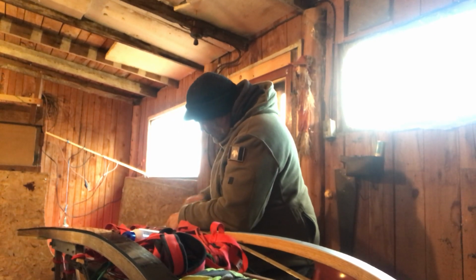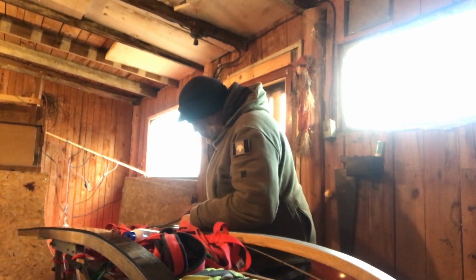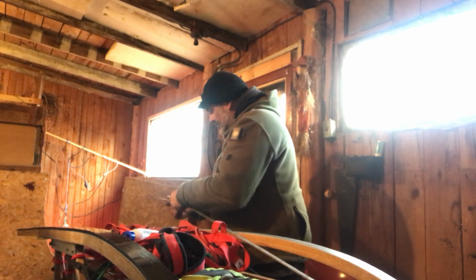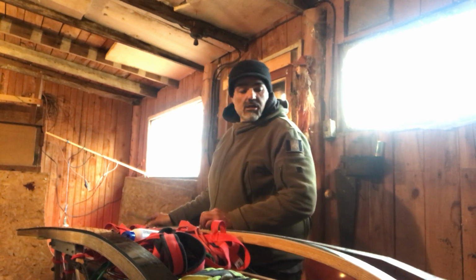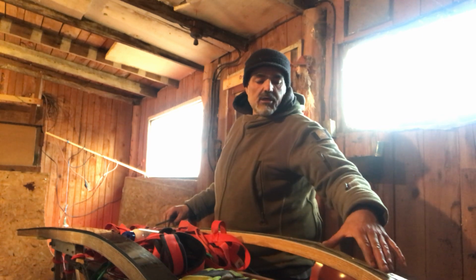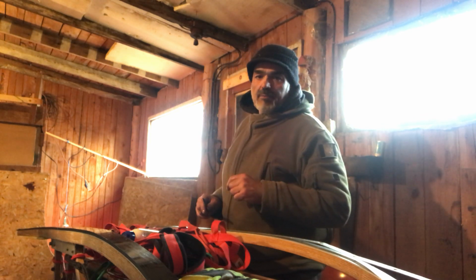Yeah, this is kind of what I did to the other one there. Spent time giving it a bunch of love on the edge, filing it with a small triangular file, which I use generally for woodworking, but it applies to both here. Giving us our edge back, flip her back over, and we'll throw the screws back in there. As I did on the other track, I found a couple of screws and exchanged them for ones that were about an eighth of an inch longer, so it's eating a little bit more wood when I put the new screws in.